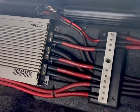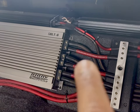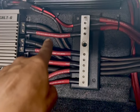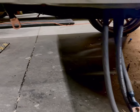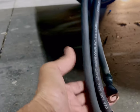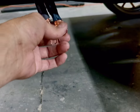All my grounds coming out of here are chassis grounds. You have three grounds coming out of here. You have a ground coming out of your mids and highs amp, then you have a ground coming out of your highs amp. As you can see, those are running adjacent all the way here. I'm going to run chassis grounds — you scrape the frame of the vehicle and drill holes through. These three wires right here are from the actual bass amp. And then you have these two here for the actual batteries. Each battery has its own groundwork.